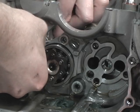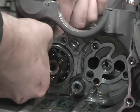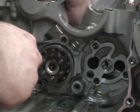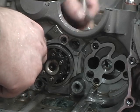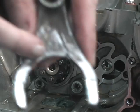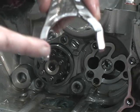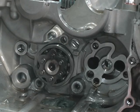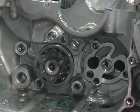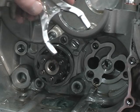Another one to go here — magnets can sometimes help, or just jimmy it and slide it off. Here are shift fork R and shift fork L. L is the one that goes against second gear — you can see mine is all chewed up. Most of the time when these get bad, you see the shine on the pad here where it's worn. I've always noticed it gets ground up here, and because it's grinding funny I suppose I should replace the drum too. This fork was replaced just 2,000 miles ago — I even went through the oil pan just to replace the shift fork.